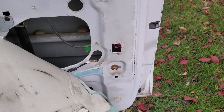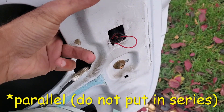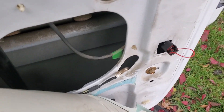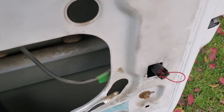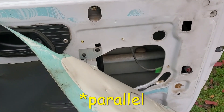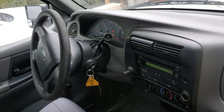As you can see that light is back on. So basically all we're going to be doing is putting that magnetic reed switch in parallel with this switch - it doesn't matter whether it's passenger side or driver side, but I'm going to choose the passenger side because there's less things in the way. So once this switch sends the signal to ground the light turns on, and if we pull it - the door is now closed - that light will turn off. By putting it in parallel with this switch, we should be able to monitor both the doors and the tailgate through that same center console light.